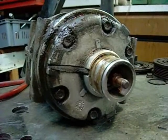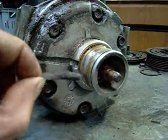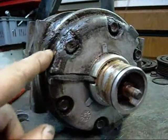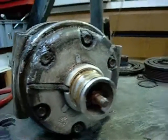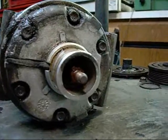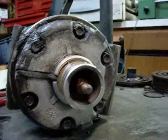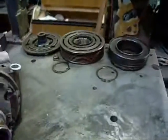With the electromagnet removed, I've found a little oil wick made out of felt in here at the bottom. The presence of this congealed refrigerant oil on the housing indicates that these must bleed a little bit of oil out of their main bearing, obviously as part of the lubrication system. And in doing so, I guess they lose their gas that way - probably why automotive air conditioners require regassing after a while.